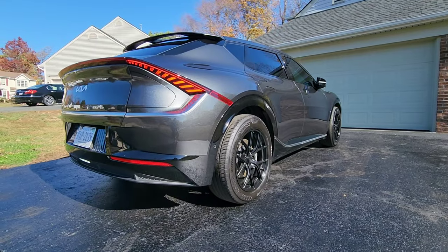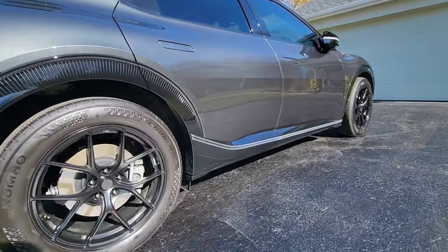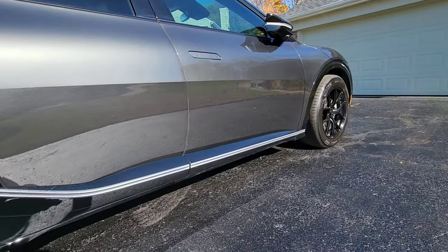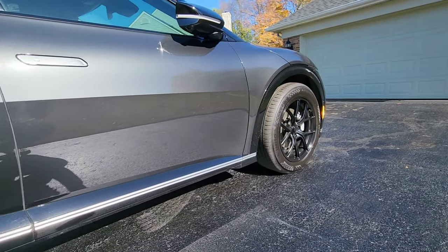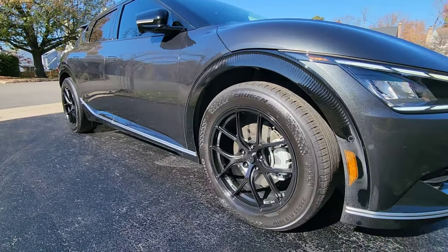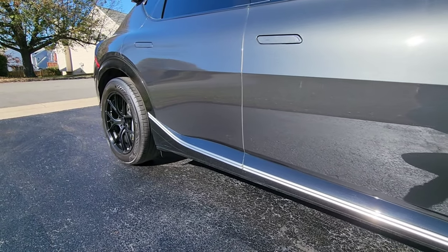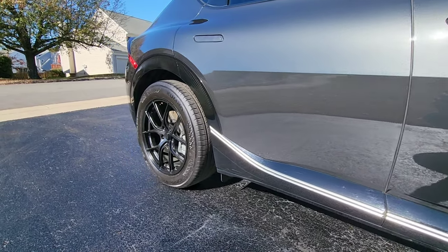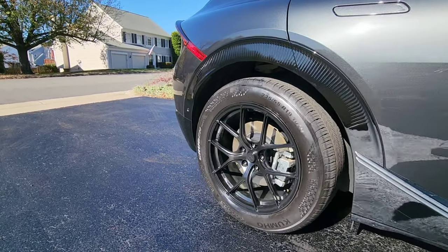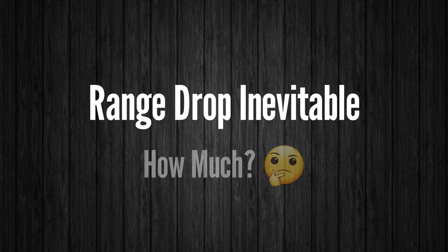I love the style of my new Titan 7 TS5 wheels — the spoke design, how concave they are, every aspect of them. But with a design like this they're certainly going to be much less aerodynamic. Every feature of the factory wheel that makes it more aerodynamic is basically missing here: it's not flat at all, there's huge openings, and it's a more aggressive offset so the tires are going to be generating a little more wind resistance as well. So I knew there would be a drop in range going to the new wheels. The question was how much of a drop.